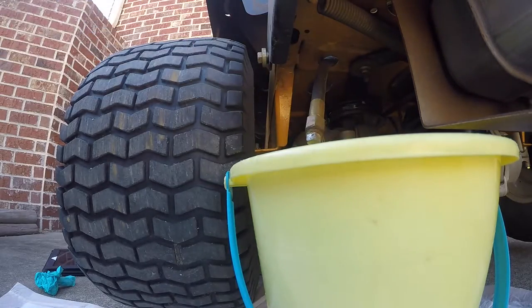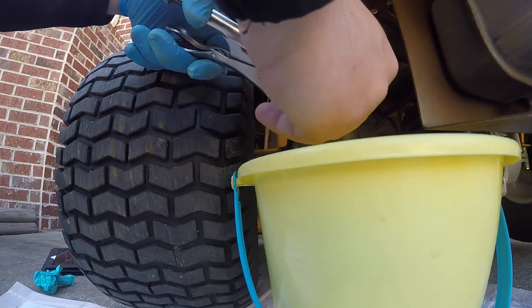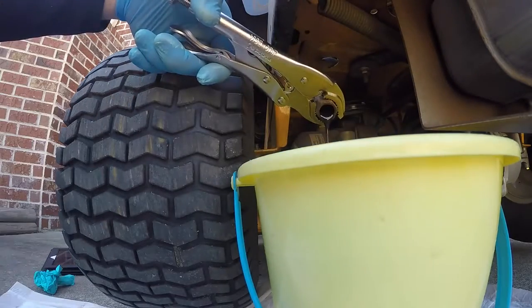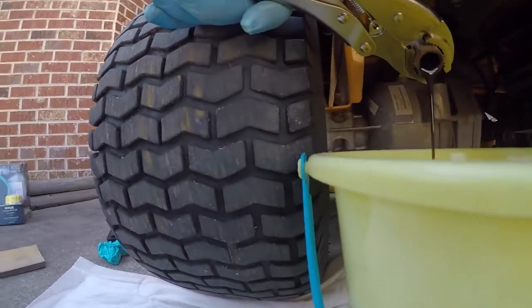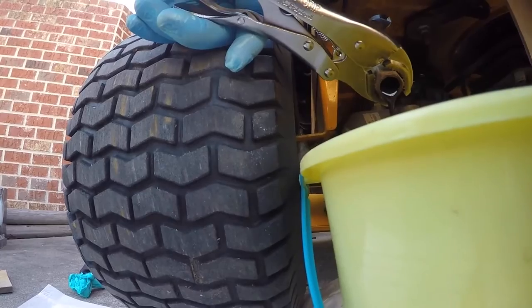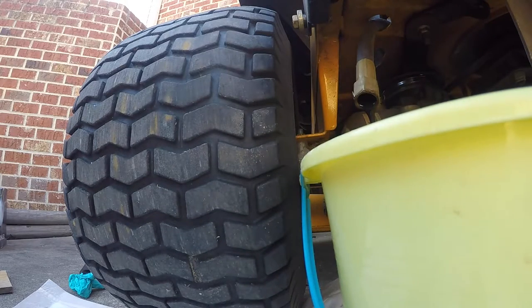Since my hose is long enough to reach over the top of my pan, I'm not going to use the plastic bottle technique. Once you get it loose enough with your channel locks, you can use your hand to loosen it — be prepared because the oil is going to start draining out immediately. Make sure that you catch your drain plug. I like to use an absorbent pad to catch any excess oil. I'll let this drain until there's nothing coming out anymore, and then I will show you the rest of the processes.